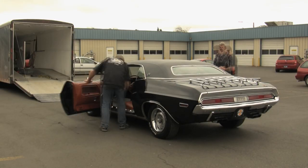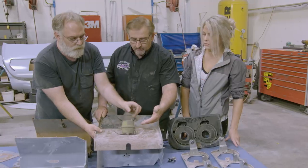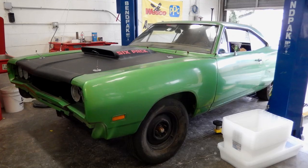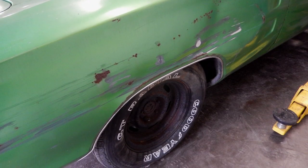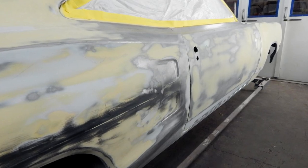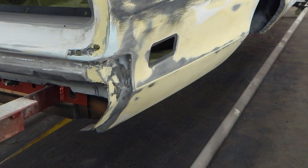It's kind of funny — this is such a unique car. With all the changes Graveyard Cars has gone through over the last decade from the time that car showed up, we've covered a lot of ground. One thing we didn't really cover much was the body work. I was here working with Ryan, my body man — a phenomenal body man. We did get some still pictures. We did not replace the fender or the door — we repaired them. The quarter panel that was caved in near the sensitive area where all the style lines are, Ryan metal-finished that off. The only rust on the car was the bottoms of the quarters; we did have to replace those, and Ryan hand-fabricated those sections.